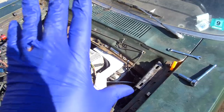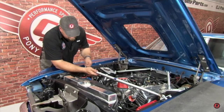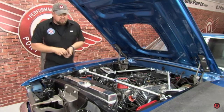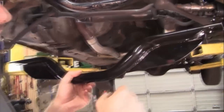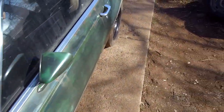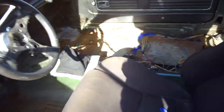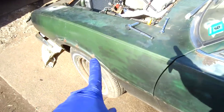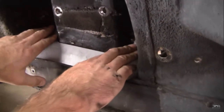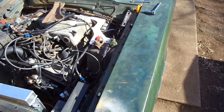Function over form — we need strut braces in the front of these cars. For those of you who have old Mustangs and similar cars, the way the unibody is set up, that is the most important thing. Forget about the belly bar underneath — that doesn't really do too much. This here is needed, along with the structural integrity of this back piece too. This little X-bar has to be blocked off as well, and that will help with the car being more rigid. I did a lot of things underneath here — the little plates, and I even boxed the lower control arm too.